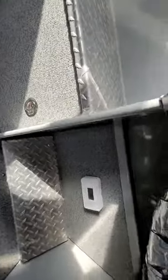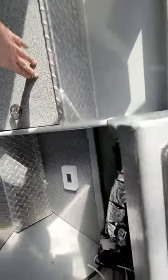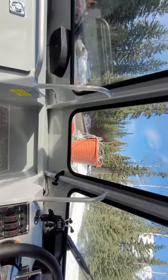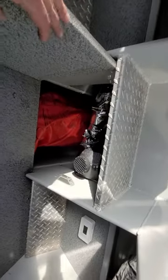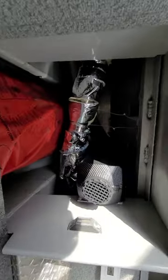This is my kick plate right in front of my driver's seat. You can kind of see where it sits. I put a carbon monoxide detector in there so it's safe when I'm running the heater. Behind my little step that goes out the front window was one of the only places I had to mount it. They can be mounted two ways - straight up and down, or 90 degrees to one side with the fuel line being on top.